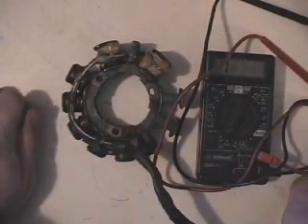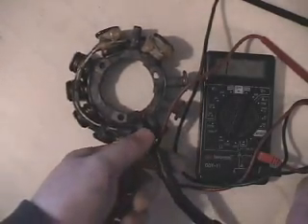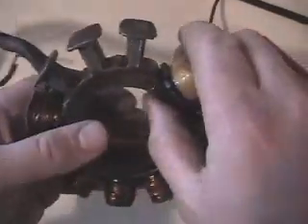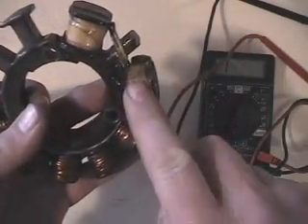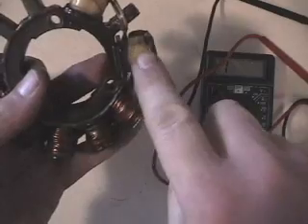We've got a low side and a high side — some people call them primary and secondary. On this stator, when you look at it from the top down with the wire coming out of the top, on your sled the wire goes down and comes out the back. Looking at it on your sled, the primary is the one that's 450 ohms, and the secondary on the ZRT600 is only 20 ohms. On the ZRT800s, 900s, and 1000s that one is 25 ohms, but on the ZRT600 it's different — only 20 ohms. The primary is still 450 ohms.